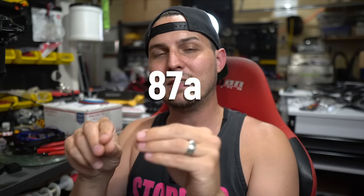We basically have power coming from XK Chrome or power coming from 87A on our first relay — both of those cannot happen at the same time, because 87A is only on while the XK Chrome is off. When you push the button on the remote control, the XK Chrome unit gets power, which automatically kills power to 87A. If any of that made sense and you're going to be able to use advanced relay kill circuits or anything like that, just say yes, this actually helped me down in the comments below. I really want to keep bringing you crazy value. If this belongs only in my online course, let me know — I am adding it to RGB wiring, which is one of the paid classes. I just want to bring you the value.